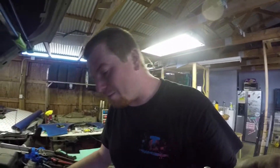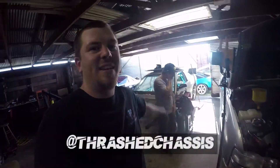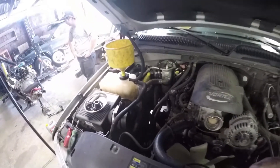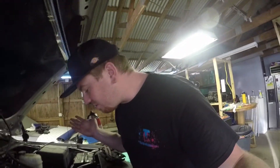Just get this thing filled up and let her burp herself and hopefully it'll be solid. Straight chunks missing out of this thing. Michael just showed up — he's going to be working on his stuff but I can finally go get a belt for the alternator. I got everything else put back together and started putting coolant in it. It pretty much just needs belts and the intake put back on and I'm going to start it up. I got my belt and now I just got to throw all this stuff back together and I'm done.